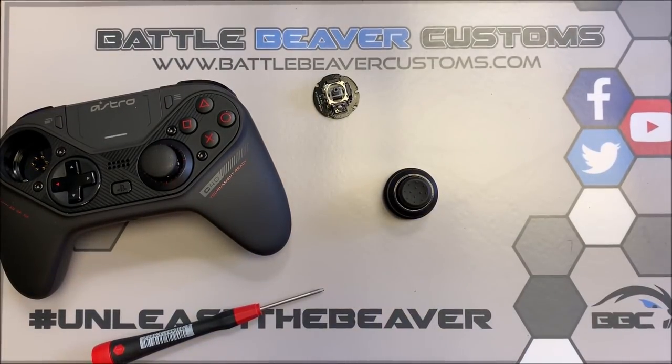Do a reset and recalibration as normal and then you are up and going. That way you can add increased or extreme thumbstick tension if you're using a taller topper, or if you're having thumbstick drift that's not cured by resetting your controller — meaning you probably have a failed potentiometer, or what we sometimes call sensors. You could buy one with stock tension just to replace it and keep your controller going like new.